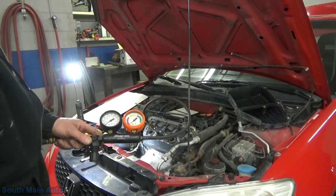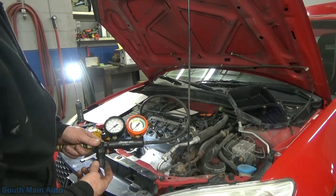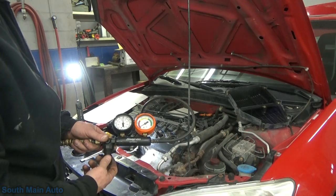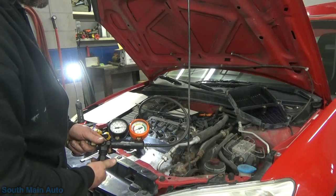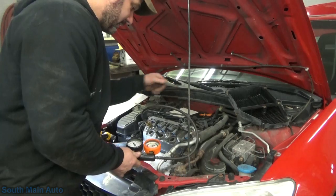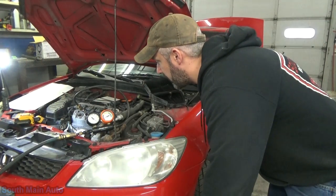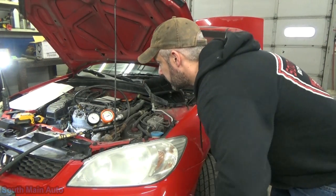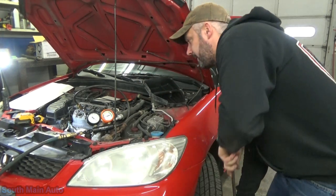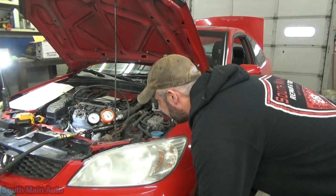Make sure you hang on to that ratchet — we're getting into some better cylinders. It may swing around and catch you in the shins. All right, so a valve must be open; let me rotate this engine a little bit. There she goes. We got moderate — moderate blow-by.